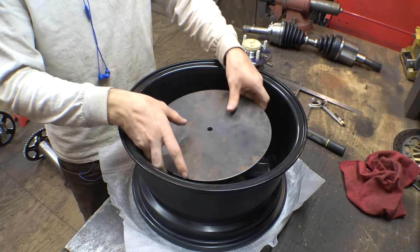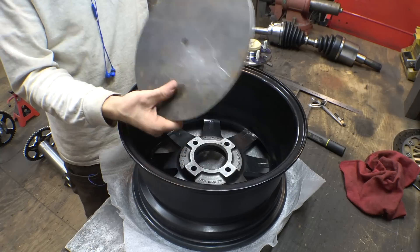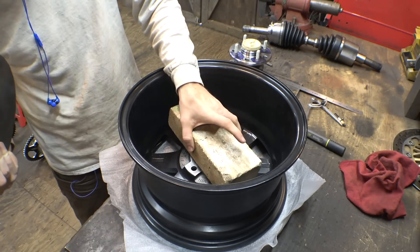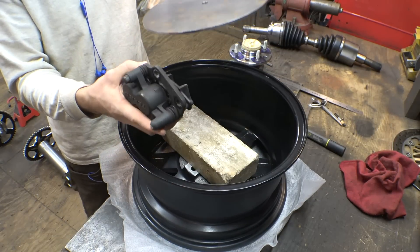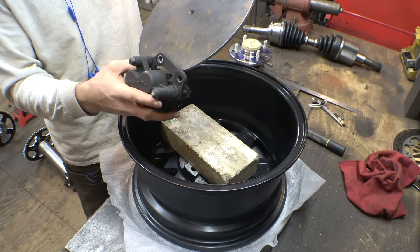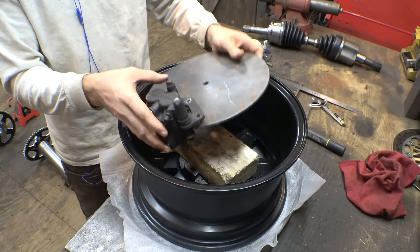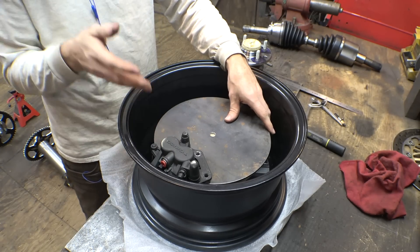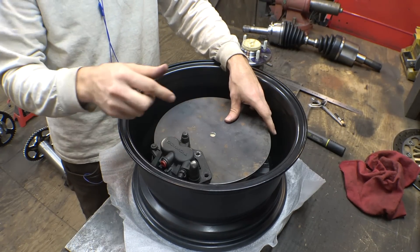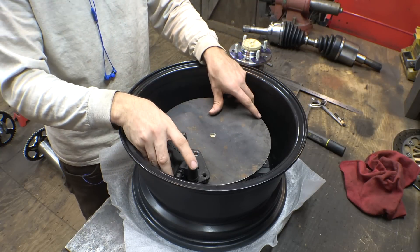Alright, so we do need to figure out at what depth we need to mount these brake discs. The calipers I'm using for this project are off of a 2009 Ninja 650. I used a similar pair for the CBR1000 project for the front suspension. These work great — they're relatively cheap on eBay, they have a lot of stopping power, and they're easy to mount. So I'm just using them again for this project.